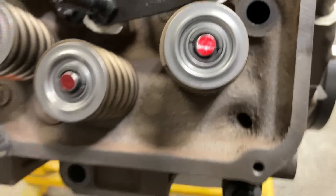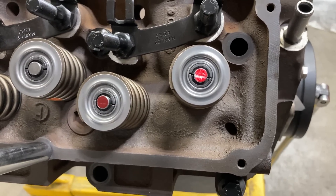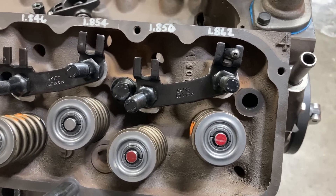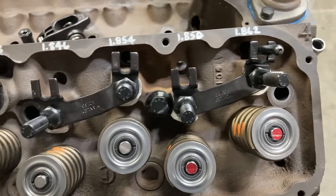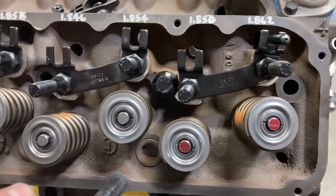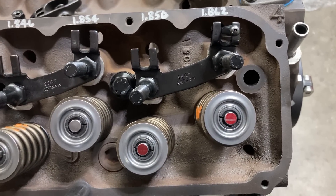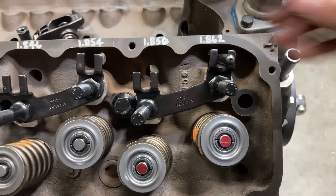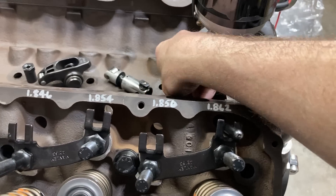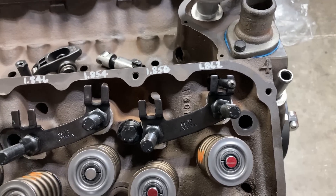It looks more narrow than that, but it's hard to hold the phone and measure at the same time. So we've got a narrow pattern near the center of the valve stem — I'm pretty pleased with that. Now we just have to translate it to a hydraulic lifter. I have lifters that are welded, so I can do what I just did and then add the amount of preload I want. Keep in mind that different lifters have different pushrod seat heights — Morel lifters have their own, Comp has their own, and I've got a modified Ford Racing lifter in there — so you need to check with the lifter you're going to use.